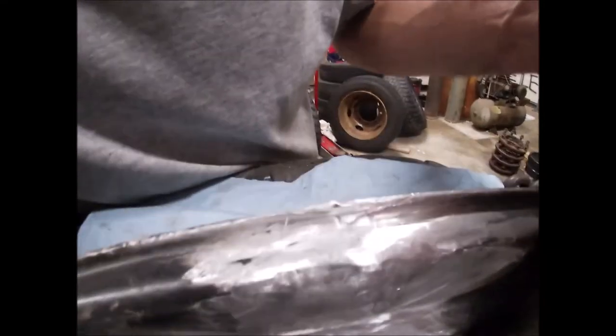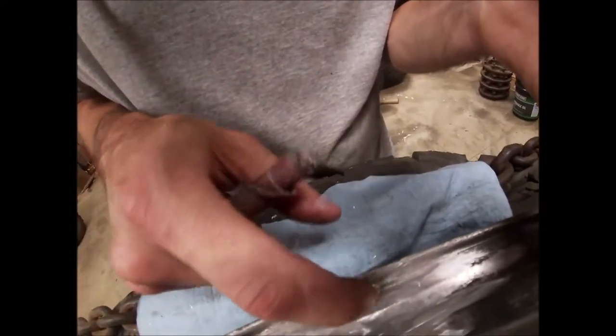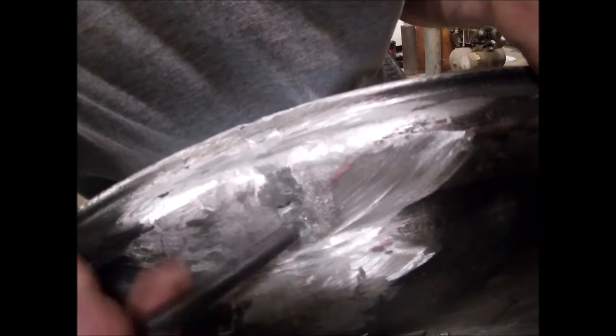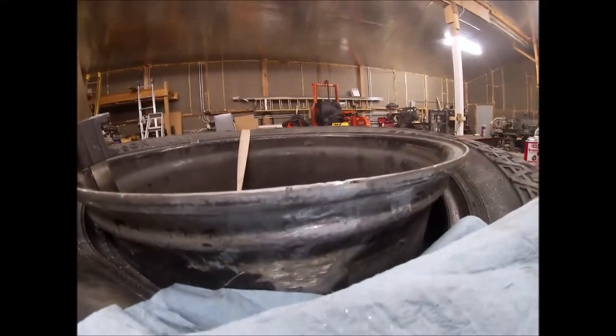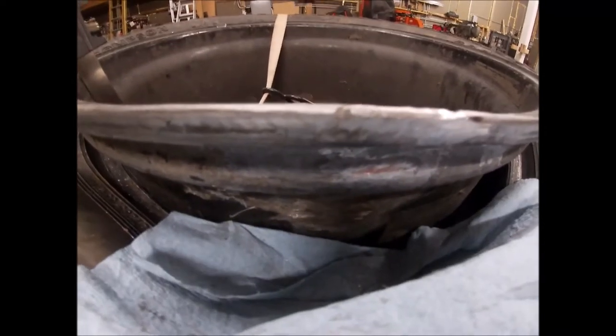And you guys can see here, the backside turned out real nice. This is pretty well the weld line right here, the crack line. So a little bit of underfill right there, nothing bad. This part here where the crack extended down looks real good. And I was able to fill this corner here real well too, if I can get in good and tight.